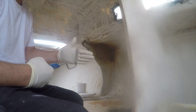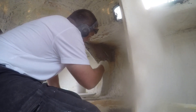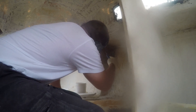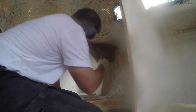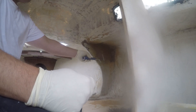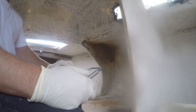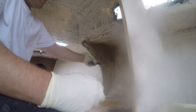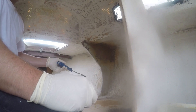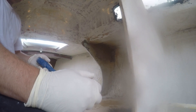My fin roller. We'll see how it works. So I've rolled out most of the air bubbles — some very small ones, but the roller's not spinning as well as it should, probably needs some acetone. I'm gonna end up sanding all of this down anyway. So even though there's a hump, it's gonna be flat. I'll fill it in with filler, sand it, and gel coat it. So that's pretty much what I'm gonna do.